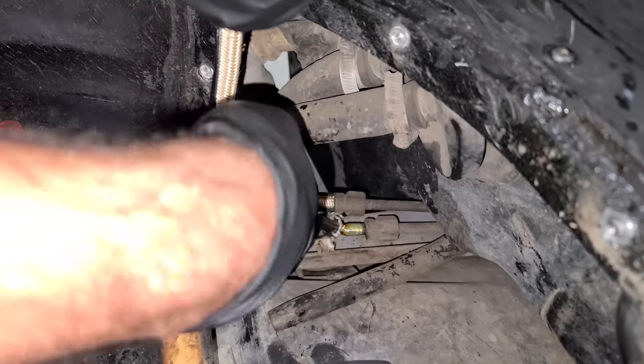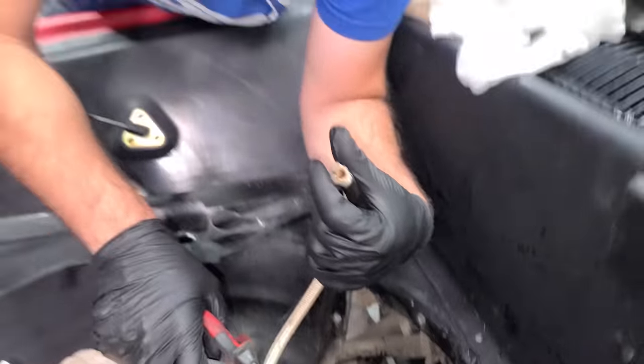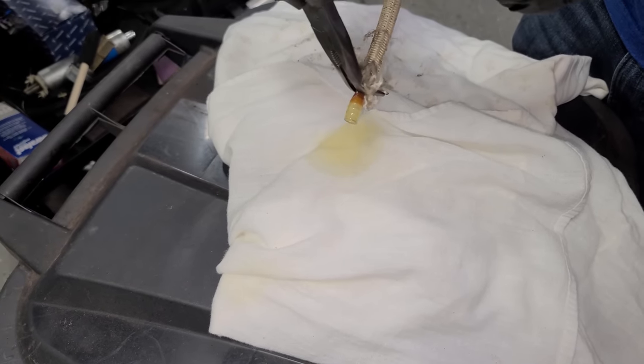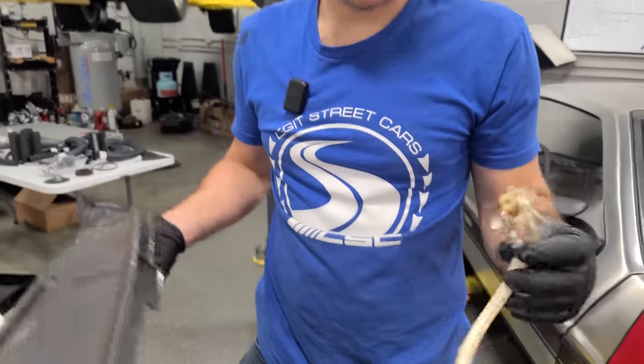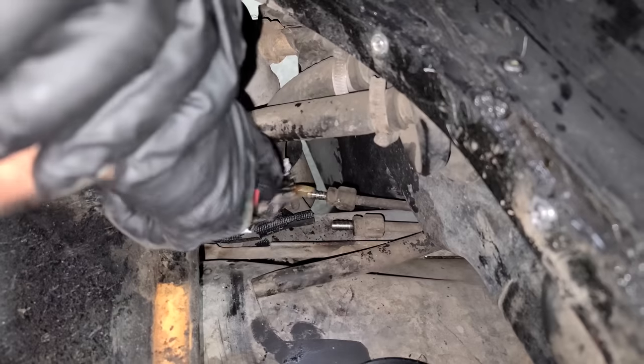There we go. Oh, hey, and there's actually clear gasoline in here, looks like. Wow, I didn't think there was gonna be anything. There we go. Okay, that's one. Well, let's take a look at what might have made it into the injectors and the fuel distribution. Okay, that's pretty normal. That's not too bad. At least it's not that molasses all the way through the lines. Okay, but this part I'm not gonna keep of the DeLorean. I'm throwing a lot of this really, really smelly stuff out.